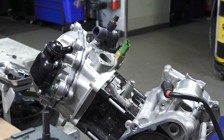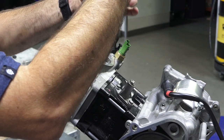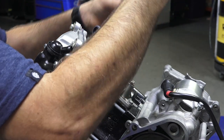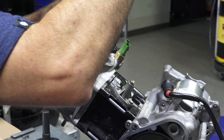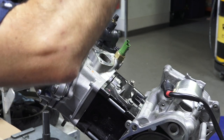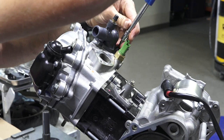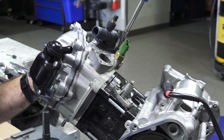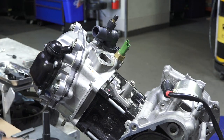And that's one downside, the fiberglass reinforced plastics that are used on engines, I mean, modern car engines use them all over the place. If they're ever overheated, they're usually permanently damaged. Well, aluminum might warp or something, but usually is salvageable. And they use these high quality plastics. They're great quality, but they use them to save weight. I'm sure cost. It's a lot cheaper to manufacture a plastic part versus aluminum casting with second op machining.